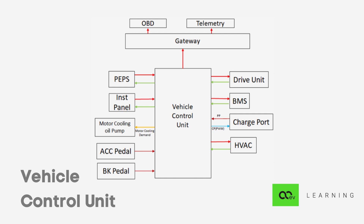The VCU is the executor of the charging communication. It gets the primary inputs of allowable charge current, maximum voltage, and SOC from the BMS. The VCU dictates the terms to the EVCC, which communicates with the EVSE after handshaking, post which energy transfer can take place. The charger or EVSE is a dumb unit — the charging profile is completely at the mercy of the EV because it has to cater to multiple batteries. It just responds to the voltage and current inputs received from the EV.